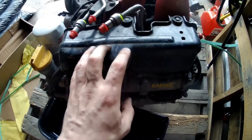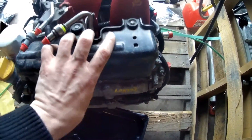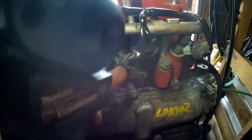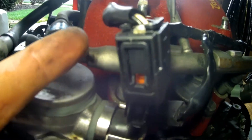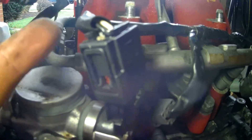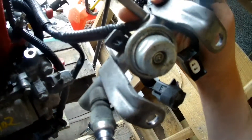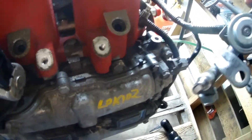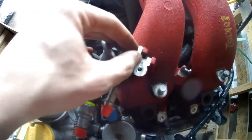To remove this side's injector shield, it's a 12mm bolt there and a 12mm bolt there, then you can pull it off. Now remove the injectors and the fuel pump. The fuel pump connector is a little tricky — you have to get a pick and press in the tab on both sides at the same time, which is the difficult part, and then it pops off. Then remove the two 12mm bolts, remove the fuel line like before, undo this clip, and the injectors are totally out.